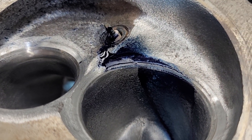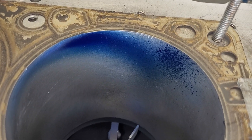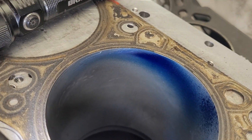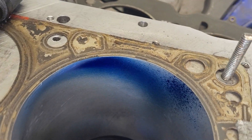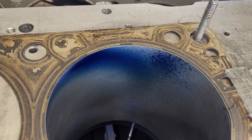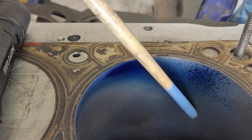Let's take a look at the bore because the bore is completely different. Now this is completely different than what we've seen before — instead of it being sheared on the chamber itself, it's all going down to the cylinder bore at this point. I'd like to get some opinions on whether that's good or bad. I do like this angle we've got here — that's telling us how much swirl we've got.